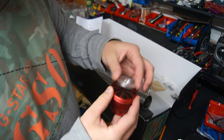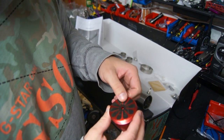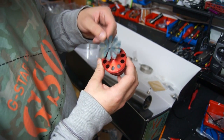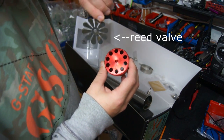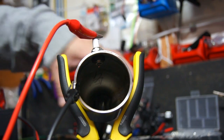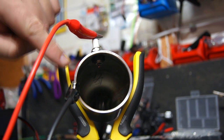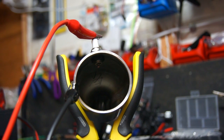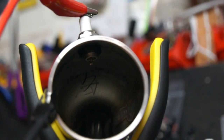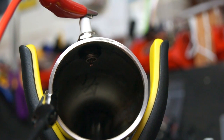I dropped a little silver washer. It seems to be a light bit of oil on there, and here's the reed valve itself — it was stuck down with a little bit of oil, you can see the residue. Let's connect the 3S battery and see if we can get our spark plug to ignite. I've propped up the jet engine using the pliers, connected the positive to the top and the negative onto the pulse jet frame itself. I'm going to press the ignition and we'll see what happens. We can hear and actually see the spark coming from the spark plug, which is going to ignite our fuel once it goes inside.